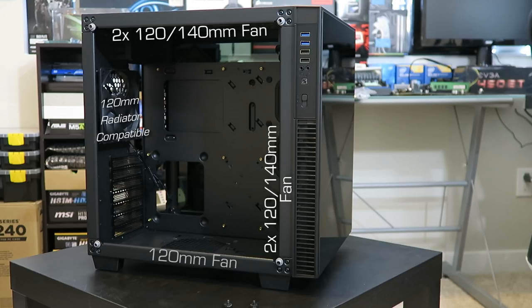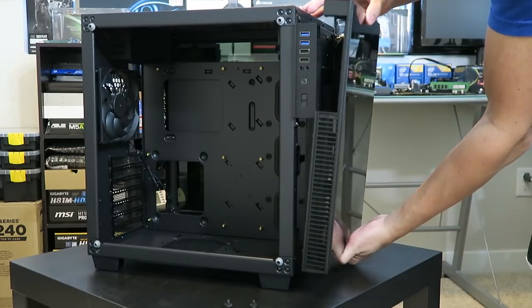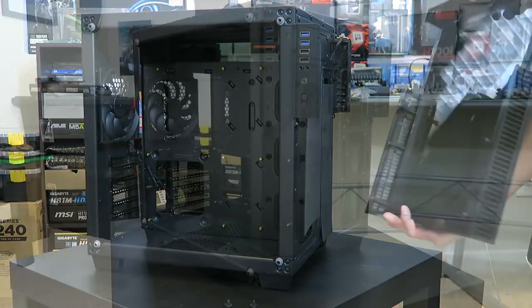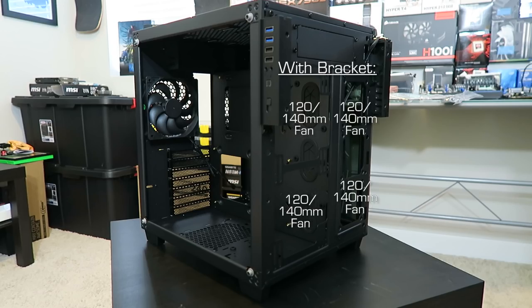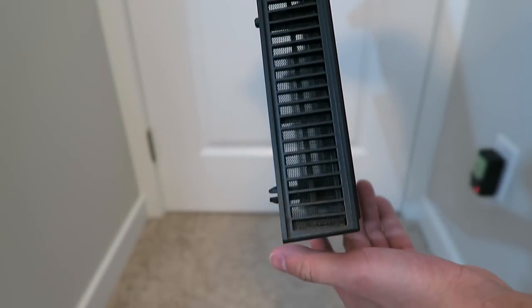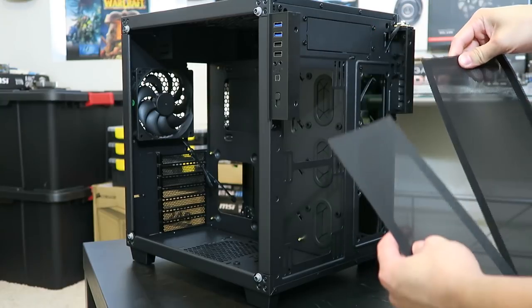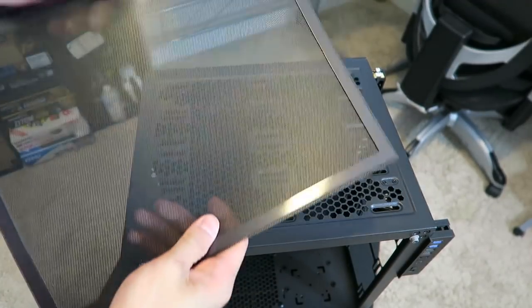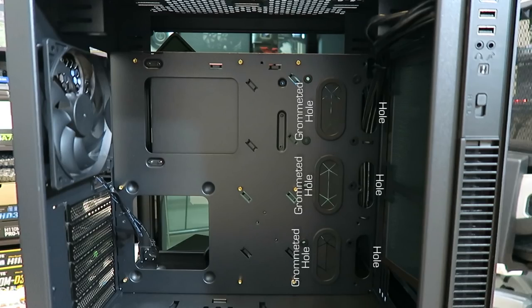If you're not using radiators, you'll be populating these zones with either 120mm or 140mm fans. The rear fan supports a 120mm radiator if you choose, and there's a space for a 120mm fan on the bottom. On the front of the case, just behind the tempered glass, you can have so many different fan configurations that it would be easier to just put the text on the screen rather than list all possible combinations. Keep in mind that fans placed here will be really close to the front tempered glass panel, making them less effective since the case is fed air through the side vents. There are four removable fan filters on the case: two on the front which are magnetic, one on the top which is also magnetic, and one on the bottom of the main chamber which slides in and out.